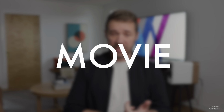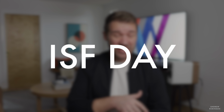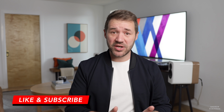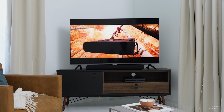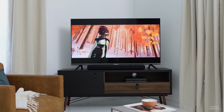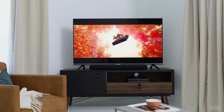And the profiles you're going to want to keep an eye out for are movie, cinema, theater, custom, ISF day if you've got it. Because out of all of the TVs that we reviewed this year, we achieved and measured more accurate results by simply changing to one of these more movie-centric profiles. And this was true across the board, except with one exception. The TCL 6 series. For whatever reason, that TV measured better in its standard picture profile with only a minor adjustment needed to its color temperature.